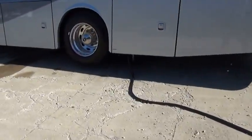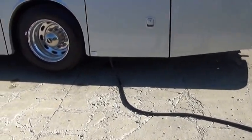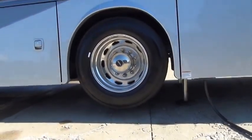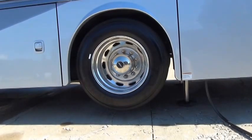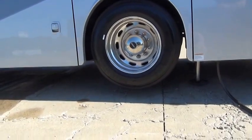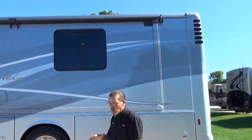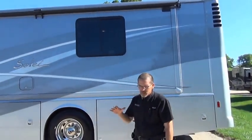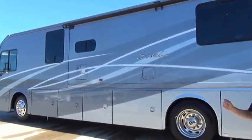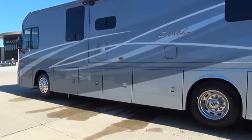Now, you can see from back here, once we stepped away, when we did our leveling, I got the tires off the ground. So, that's okay, but it's better to have the rear tires on the ground, because that's our park brake, that's our anchor. I get the rear ones touching, so we would be fine. But if you're in a situation where tires need to leave the ground because we're extremely unlevel, it's best to let the fronts leave the ground and keep our rears landed.